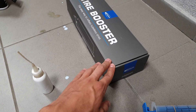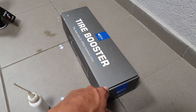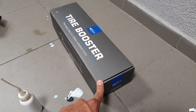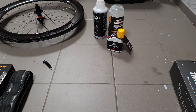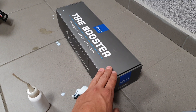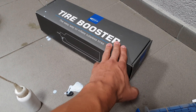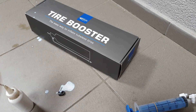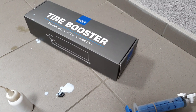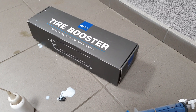For inflation, some reviewers mention fitting tires with just a standard floor pump, but I had zero success with road bike wheels and tires that way, so I just go straight to the compressor. Sometimes it doesn't even work with the compressor, and then I use the tire booster — I got this one from Schwalbe. You pump it up to 140-160 PSI, pop it on there, and the tire seats into place. After that you're good to go.